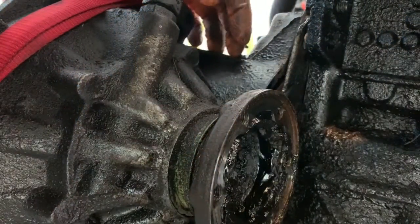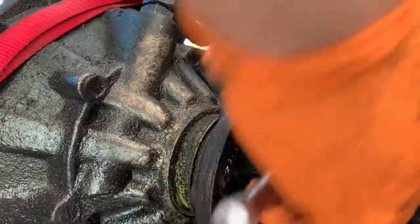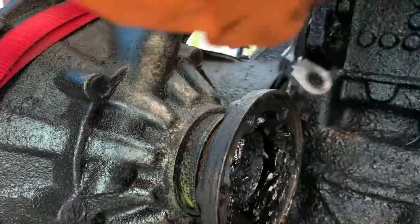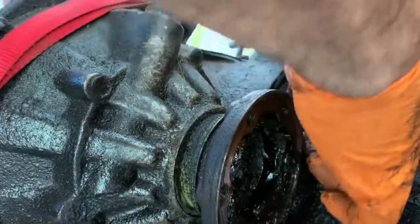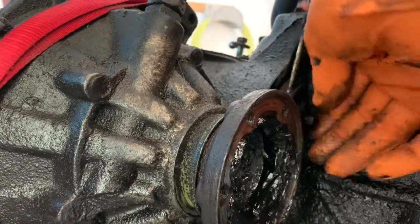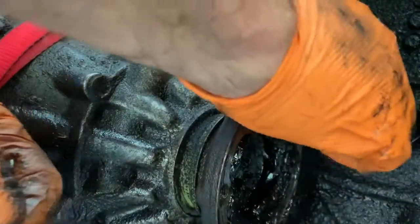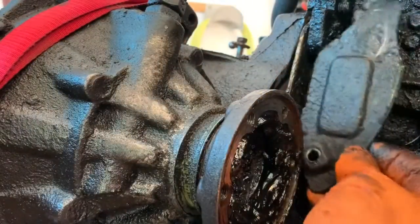There's one there, and I think there's one down in the corner somewhere. Or is it just the one bolt? Literally just one bolt and a tab. It's just like a cover plate to keep all this oily mess from going in and landing straight on top of your clutch. This little 10 mil should do it. What a mess, eh? So that way I can hold it for the ratchet action. There we go, it's coming out now. Man, that's tiny. There. So that's the cover plate.